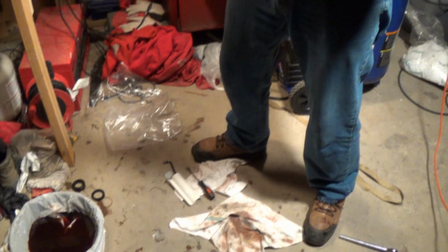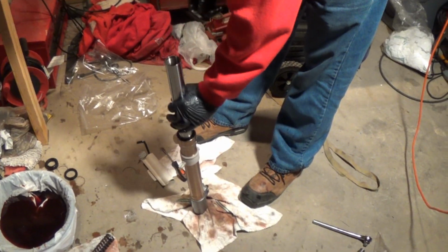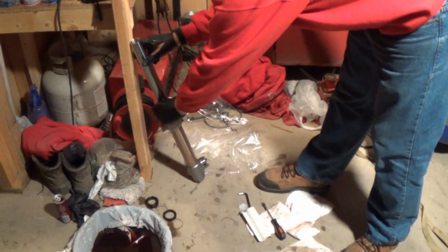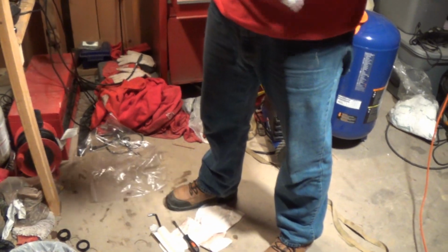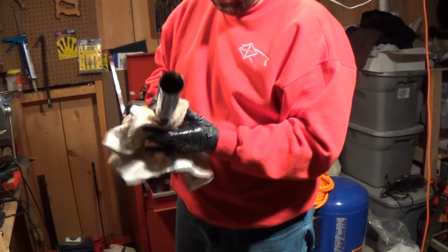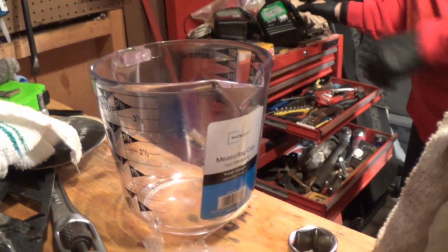Now my manual says 19.9 fluid ounces. I just put 20 in it. It's going to make it just a little bit stiffer, but that's alright for me because I'm not your average weight for riding a DR anyhow. I'm probably a little heavier than most people. Your average rider's probably 170 pounds or so. Don't look at the bench, it's all messy. Just look at the oil.